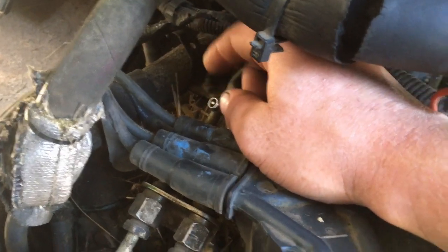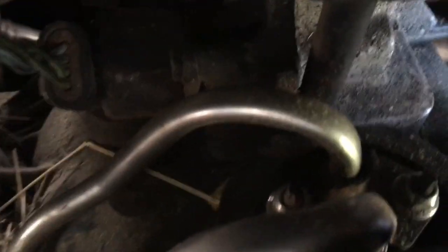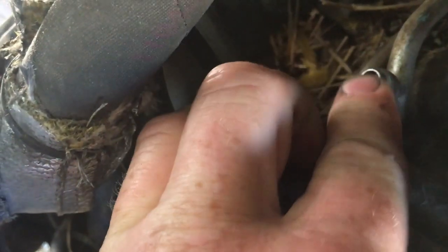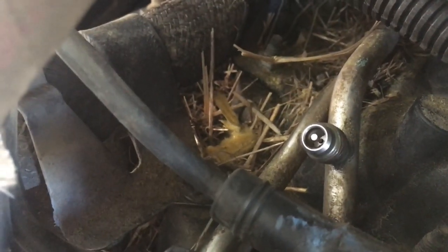The first thing I checked was the fuel. You can take a fuel pressure gauge if you have one and put it on here, but I didn't have one. What I did was take off this box right up here — it just clips off on both sides. Right behind there are the fuel rails, and there's this little clip here — I believe those are 5/16. I took that out and turned the pump on and it was squirting out fuel, so I knew that was working. You can also turn the key forward and press this little valve right here — push it in and fuel will spray out. I think it's around 60–65 PSI is what you're supposed to be getting. I didn't think it was a fuel issue but I wanted to get that out of the way first.